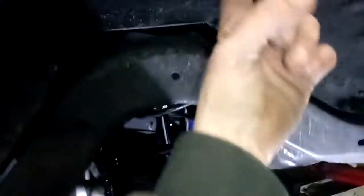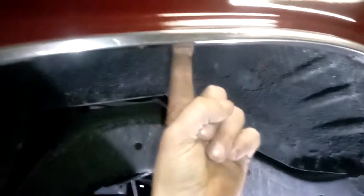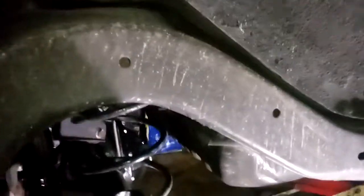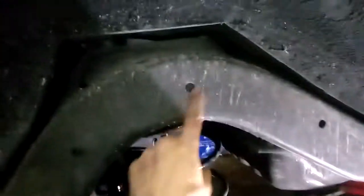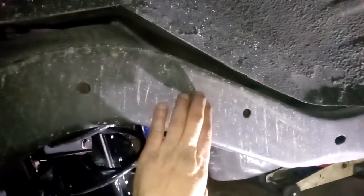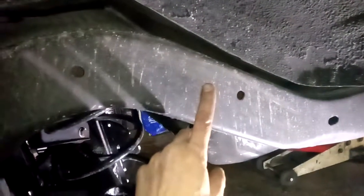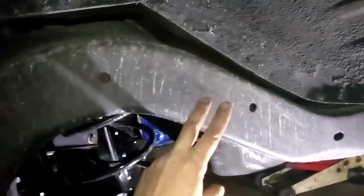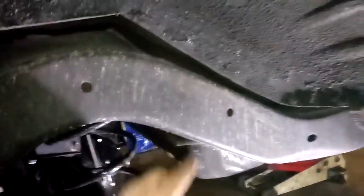As for clearance, I was wrong — I said three quarters but it's actually about a half inch clearance from the lip to the tire, not the rim, because you've got the bow of the tire. That's the half inch. From the highest point of the frame to the tire, I still have a good two inch clearance. So I could run my rims out two inches wider and still have a half inch of clearance — and that's with the spacer on there.